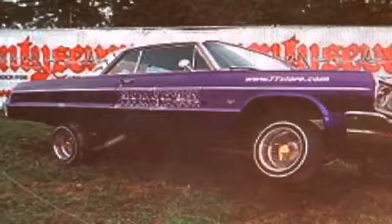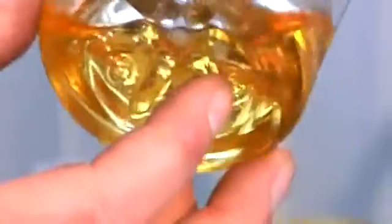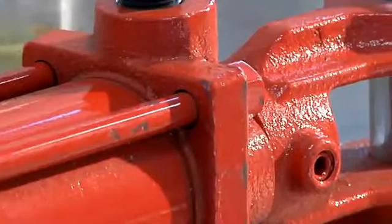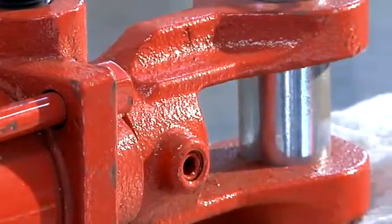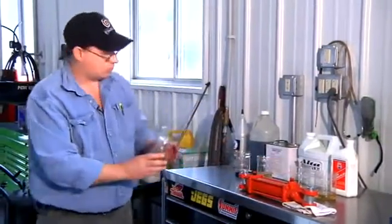This oil I've put in here just to give you an idea of viscosity. As you can see, this oil is quite a bit thicker. It could be used in your hydraulic system — it would work and it would make this cylinder go back and forth, although it would go much slower because it takes more energy to move this thicker fluid through the ports.